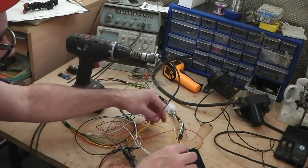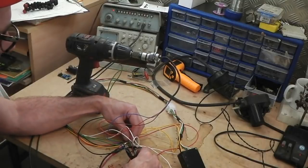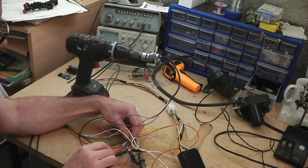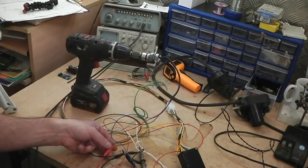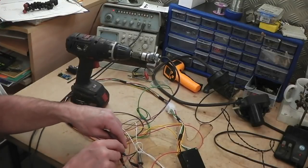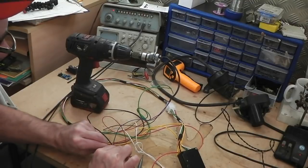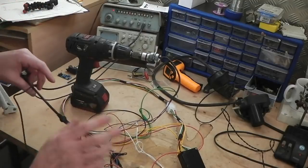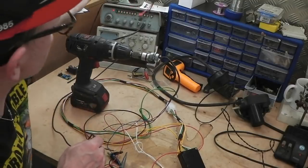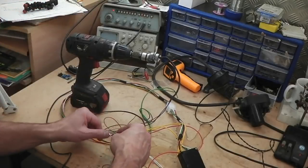Now I'm going to disconnect out of the circuit my generator. I don't need it. I'll leave the scope on. I'm going to take the signal generator out. Here it is, here's the signal generator crock clips. Uncrock them and take that out of the equation. So we've now got no vehicle speed simulator on. 12 volts is going to come in.